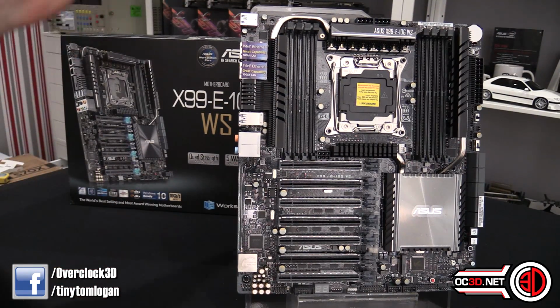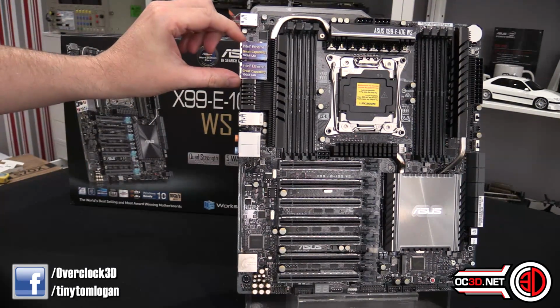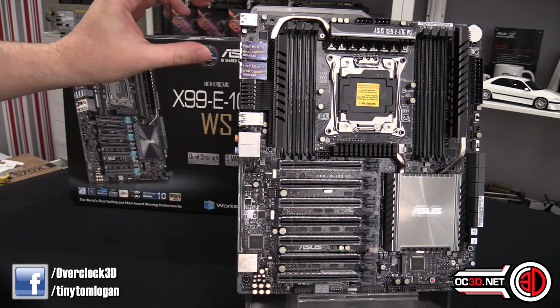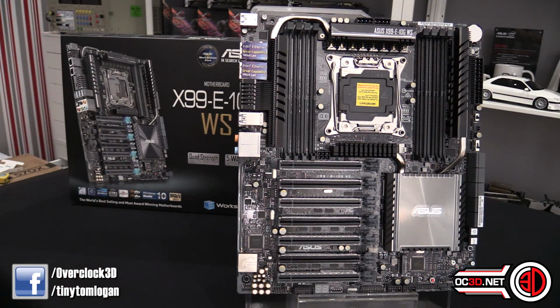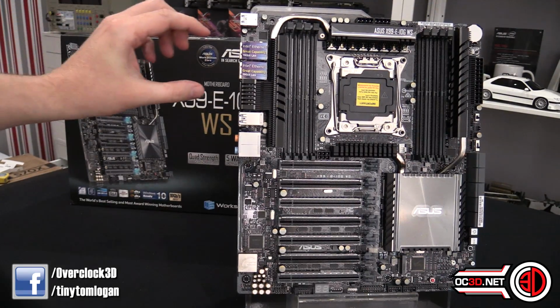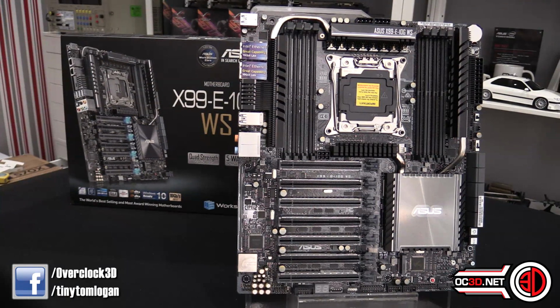It won't magically make your internet or your downloads faster. This is about home networking. So if you want to use this, it needs to be going into a 10 GBE switch or other 10 GBE devices. So it's a very limited use, and it's very professional based at the moment, but it may come through as being a more mainstream thing in the not too distant future.